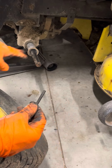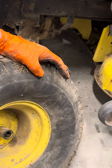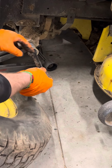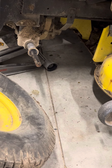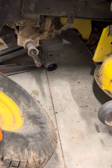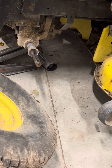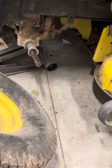If yours is missing this, if you don't see it in here, sometimes they get stuck in the wheel and they'll just be chilling in there. So check both places. If you do not have one, go and order some of these online or at your local small engine place, and check both sides of your lawn tractor — this wheel on this side and that wheel on that side. Hopefully that's your problem — super easy fix. Your transmission hopefully isn't bad; someone just took the tires off, put new tires on it, and didn't know that there was a keyway in there. If that is what happened to you, count your blessings because that is a very easy fix.